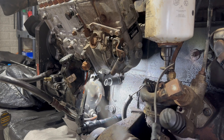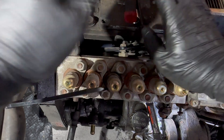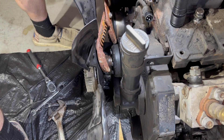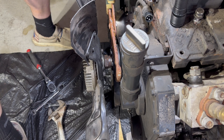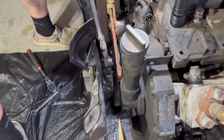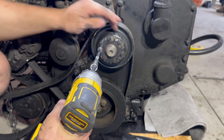Just hitting it with a couple of extensions. There's a 10mm down here that needs to go, a fuel fitting that's a 9/16", and a plug that's a 3/4". To get the boost reference line off the AFC housing it's just a 1/2". To get the fan off I used a big pair of channel locks around the pulley, then a crescent wrench — you turn it clockwise because it's reverse thread. It wasn't too tight but you might need to hit it with a hammer.